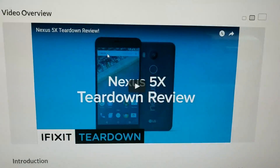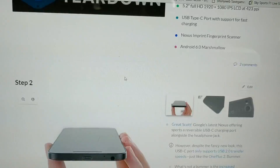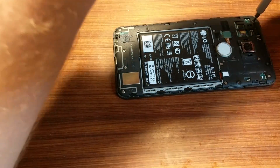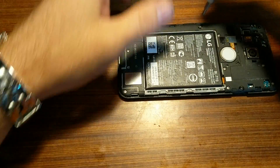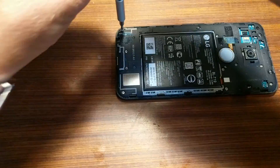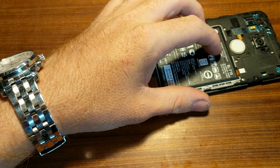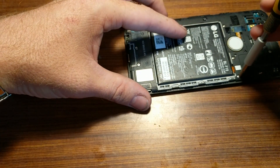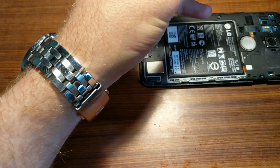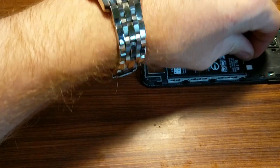You can always check out a teardown before disassembling your phone, as it will tell you how to avoid breaking anything. I've read the disassembling guide and I'm ready to go. What's great about this phone is it uses Phillips head screws and requires minimal use of those horrible plastic spudging tools. The back cover can actually be fairly easily removed just with your fingernails. It's so nice having a common phone where the disassembly is documented, rather than inevitably ripping a ribbon cable. We're going to take the phone apart, remove the motherboard, heat it up with our hairdryer, put it back together, and hopefully it'll run long enough to recover my files.